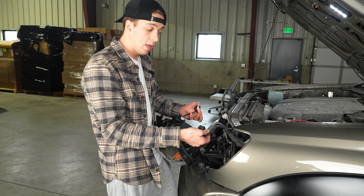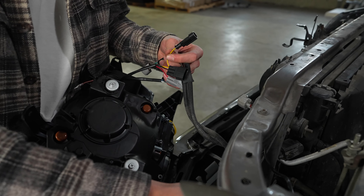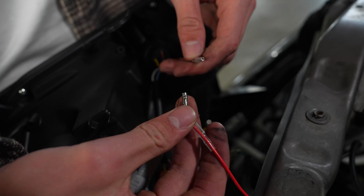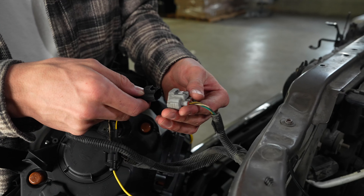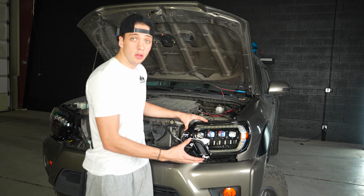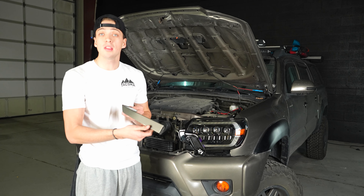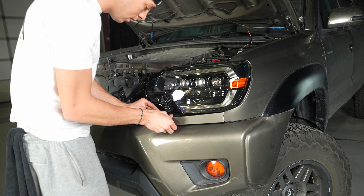Now that wiring is done, plug the connectors back into the headlight. The yellow one goes to the matching connector from your wiring harness, the little red one connects to the brown one, and then use the rubber covers that come with it to cover the connections. Once your headlight is seated, replace all the screws — the side one is a little tricky to line up, but work it until it's right. Then repeat the whole process on the other side of the truck, and replace the lower trim pieces — they slide straight in underneath the light and clip down at each end.